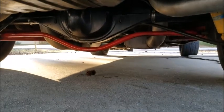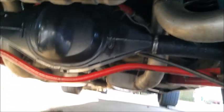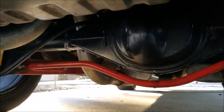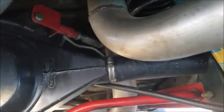The rear is a Quick Performance housing - nine-inch, custom ordered to fit the LT1 F-body brakes. Tank is a GM EFI tank with the EFI sending unit, Walbro 255 pump in it. The housing fits quite well in this car. UMI solid sway bar, UMI lower control arms, UMI adjustable uppers so I can center the rear. The LT1 brakes need a little bit of clearancing but they fit - could probably mount them on the other side and wouldn't have had an issue. The e-brake is fully functional - had to work my way around that one.